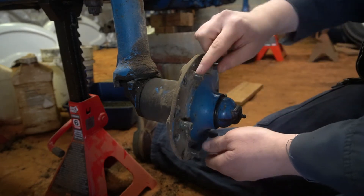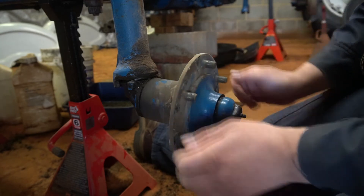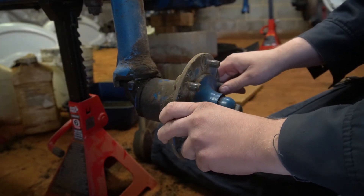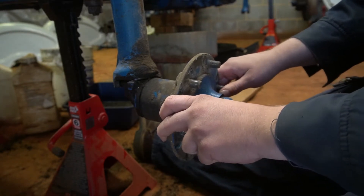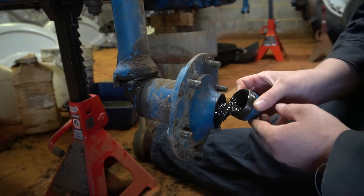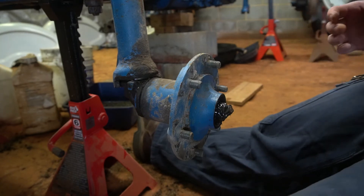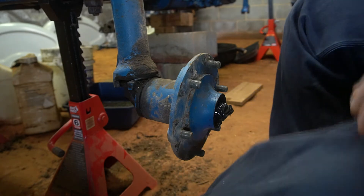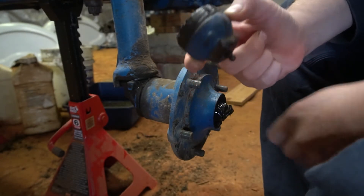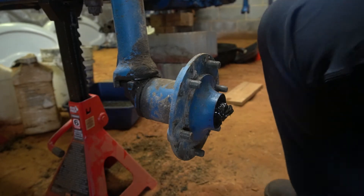Okay it comes off. I don't know if you can pick that up on camera but that bearing doesn't sound too good. And there's a good shot of how worn out the bushings are in the axle knee. The spindles themselves aren't moving. One thing I did was grab a rag because even without the grease fitting, these things are going to be covered in grease, so be prepared for that. I'm actually going to replace this bearing cap — Dennis Carpenter actually reproduces them, made out of cast steel. They're like the originals, pretty nice, and they're cheap. You could probably weld it up and grind it smooth, but I'll just be replacing it.